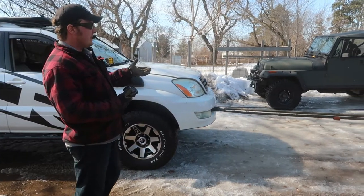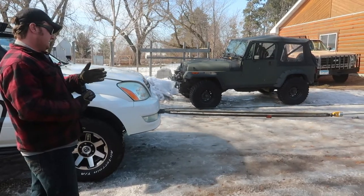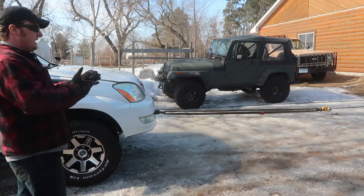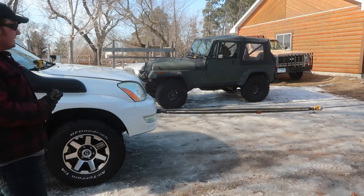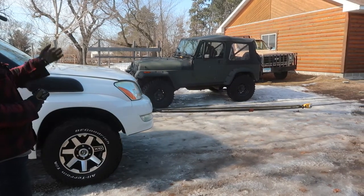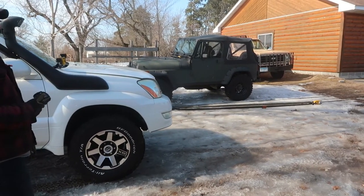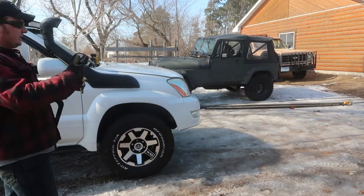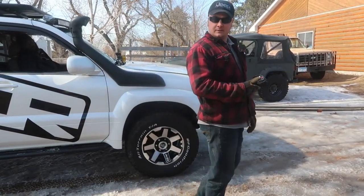One thing to keep an eye on if you are winching is for the cable to lay flat as it rolls in and out on the drum, and that it doesn't roll over itself. Synthetic isn't so detrimental, but with steel cable you can actually pinch and destroy the cable by overlapping it and then tightening it. And you can bird's nest it too, where you're not going to get it out later.